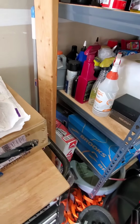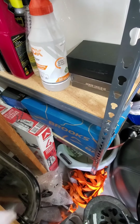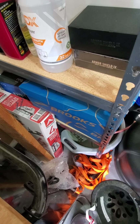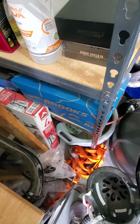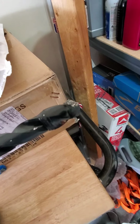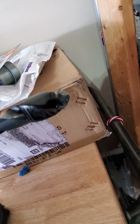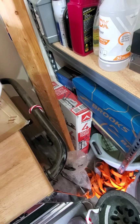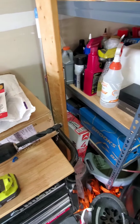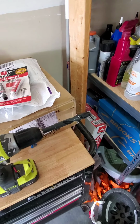And as you can see, I only left about a 1/4 inch, or less if even that, to make sure you don't hit the pickup tube inside the oil pan, because then you'll have to pull the motor, which would suck.